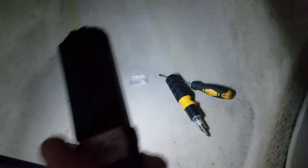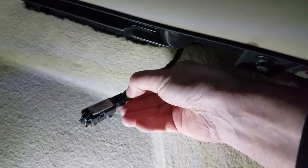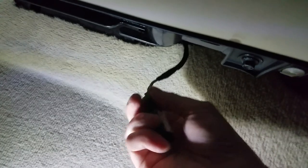This lens comes out of the hole right there. All you have to do is unclip this — it's just a little tab that you push. It's easier to do with two hands though, and that will come right out. There's a little tab that you depress right there, then it'll come off — or maybe the bottom. Yeah, the bottom — and this whole thing comes out. So if this happens, let me take you outside of the car and show you how to put that back together.